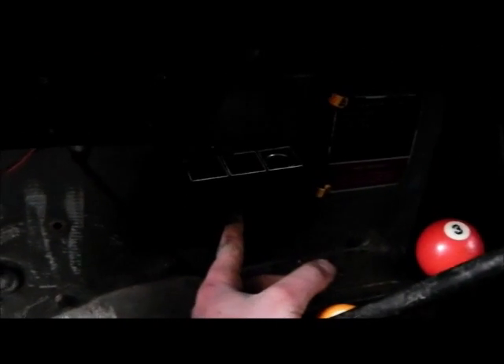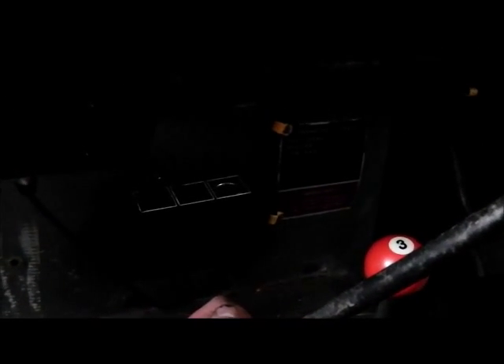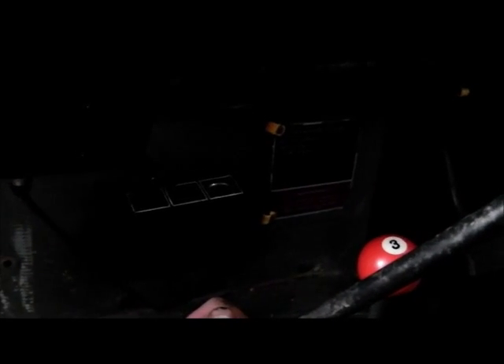I've repaired this. All the connections inside looked a bit dodgy — the actual solder joints are okay but they don't look very strong, so I've strapped up the cables so they can't wander. The idea is nothing can short out then.